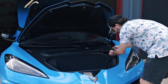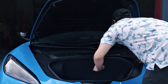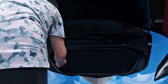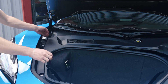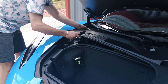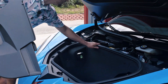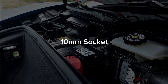When you're taking off this main plate, you do have christmas trees on both ends — just try to get under them, that's going to be the easiest way to get this thing off. The rest is just going to clip out, so it's just going to pop out; you pull out on those but these you want to pull up. Now we got that cover off — here's our battery and our negative lead. We're going to get a 10 mil, take that off, and it'll be disconnected.